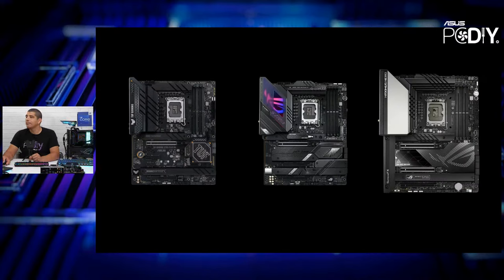Supreme FX audio design also is the only series that has the ESS Saber DAC. This uses the ALC4080, and then here we use the prior S1200 series audio, but it's still fully isolated audio, and you still get a DTS audio suite, but it's not as comprehensive as the Sonic Studio audio suite. These also come with GameFirst packet priority software, and this comes with a more basic Turbo LAN application for packet priority optimization.